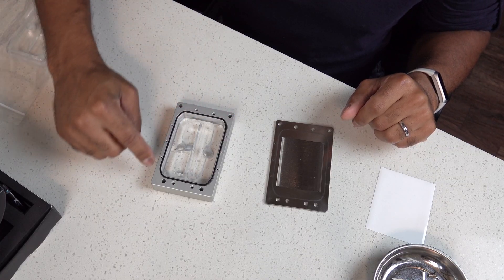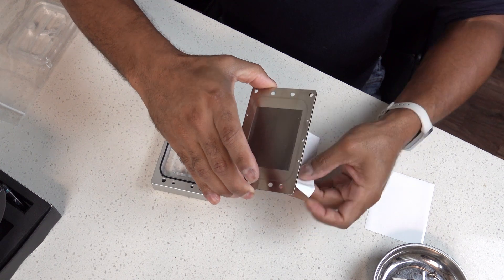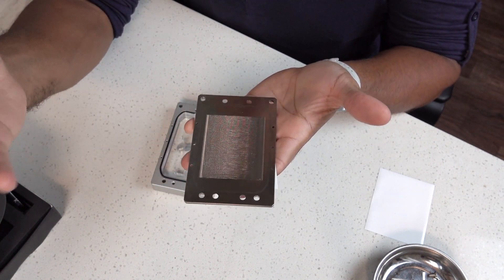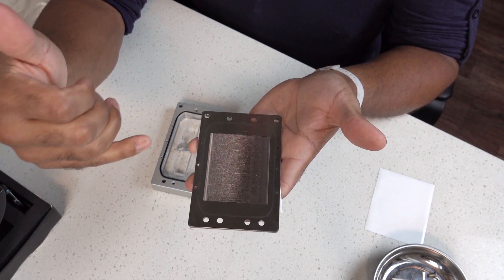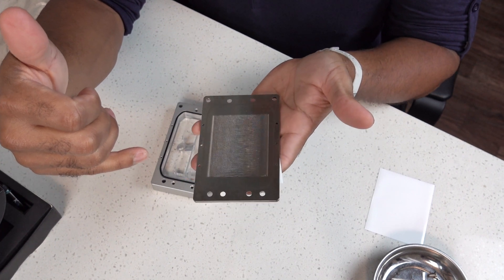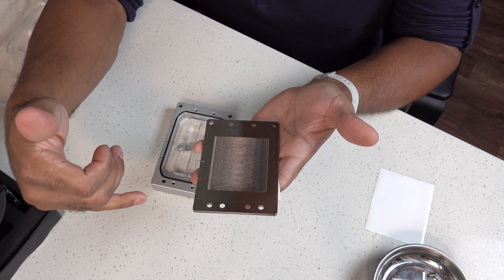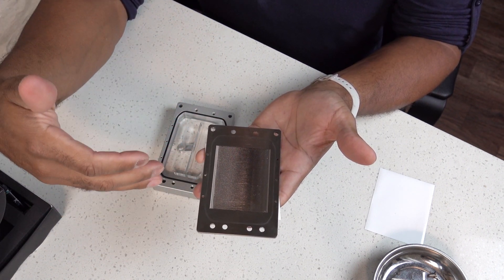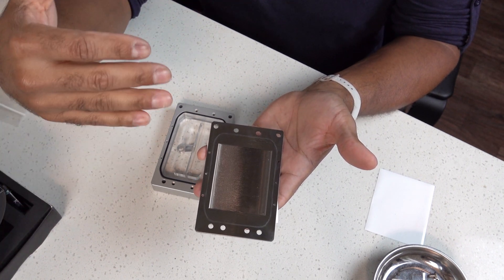So this is impressive. This is the O-ring around here - this is what basically is holding the fluid away from spilling outside of your system. And this is what really impresses me - this is the cold plate. You can already tell, because this is straight out of the factory, that there are little tiny bits of machinery - probably plastic - that are in these fins. There are 225 fins in here supposedly. They are very, very fine - I don't think I've ever seen a water block with such fine fins. And this is covering more than 100% of the entire IHS of the Threadripper 3 processor. This is a good example of why you always want to flush your radiators and flush your water blocks before you put them in the system, because these fins are really fine. Always clean your rads, always clean your water blocks.